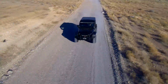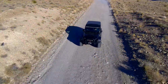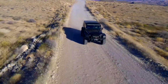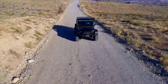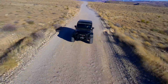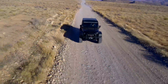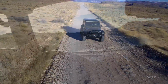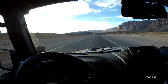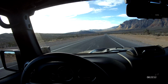So if we start off with the Hemi, essentially a Hemi is a Chrysler product, so it can use the OE Chrysler operating system and modules. If you take a JK with a 3.6 or a 3.8 and then you import the engine performance segment to the V6 PCM or ECM, there's some compromises there. When a manufacturer submits a vehicle to the US EPA for certification, there's a lot more than just engine performance going on. There's onboard diagnostics, and we've all heard OBD, OBD2.